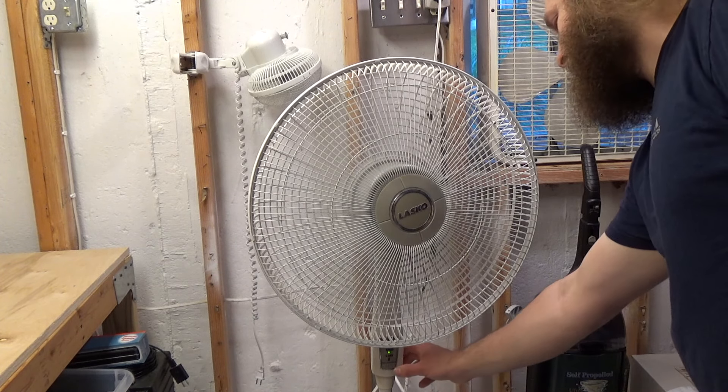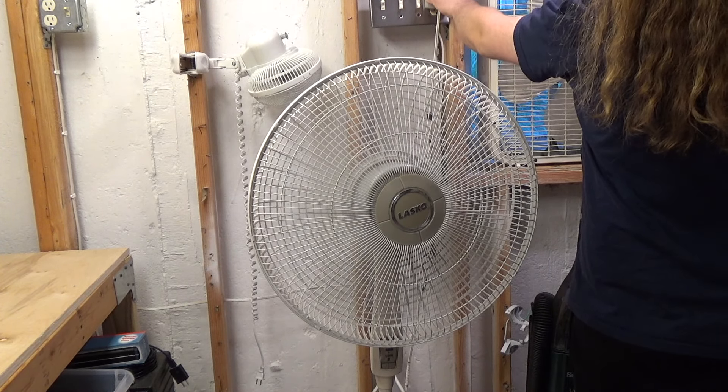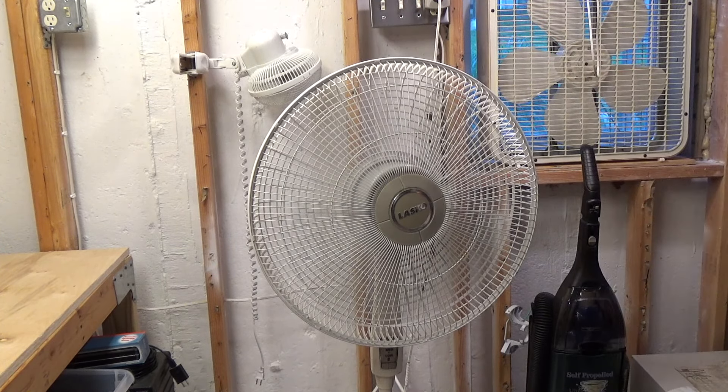That's a really pretty small amount of power for a larger fan, and the performance is quite satisfactory. I think the metal guard helps a lot — those thick plastic guards are just not very aerodynamic; they restrict a lot of air and make a lot of noise. On medium there's a pretty good increase in speed, much more powerful than low. It's getting kind of noisy, but it's moving a lot of air. This is 0.71 amps, 85 watts, with a power factor of 1.0 — so the motor is at least halfway decent.